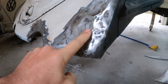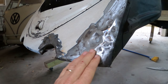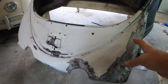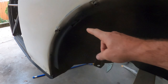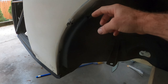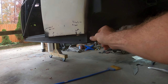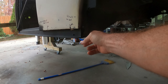This is also a pretty big dent, so I'll use fiberglass bondo to come down on that. Then I think I can use regular bondo — I don't need quite as much structural support. Coming around here there's a kind of big hole, so I'll put fiberglass bondo in this as well, and I may use some fiberglass underneath. I probably need to do something similar for the hole on the other side.